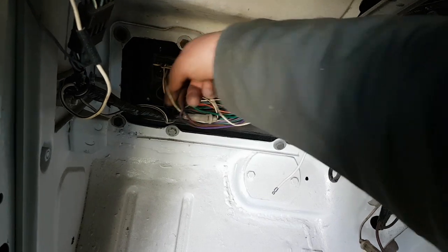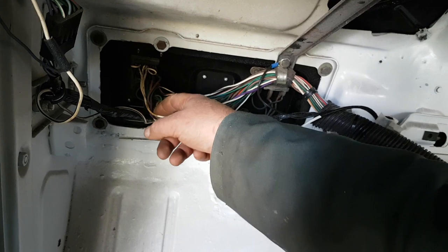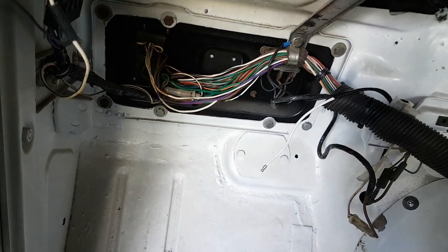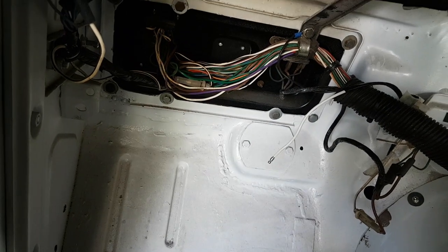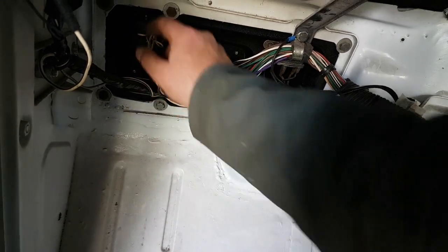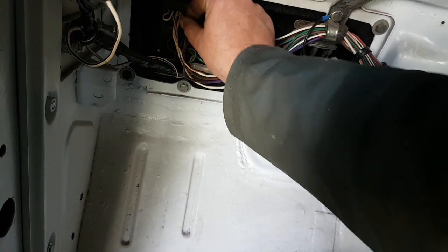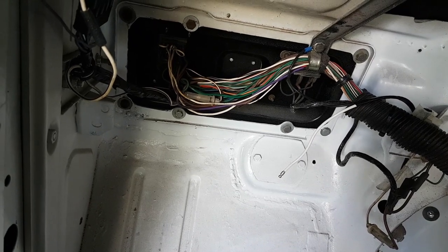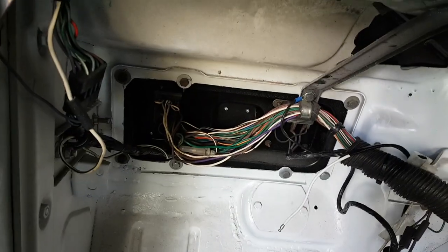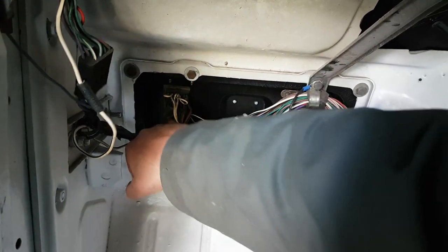That wire comes from the ignition switch. We know that one already. There's only one other wire that goes back, and that's this wire here. And that goes back. What I don't understand is where this bridge is working out. So I'm going to have to get my torch in here, I think, and work out how these bridges work. Because I would have thought there'll be a bridge between the fuses, because there's two connections on the back of it, like there is on my Stag, which has got all of the white circuits bridged together across the back of the fuse board on the unfused side. This is the unfused side, that's the fuse side.